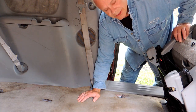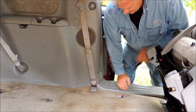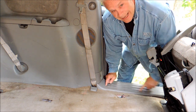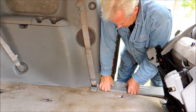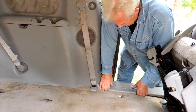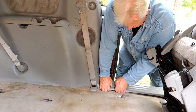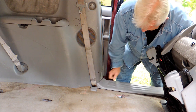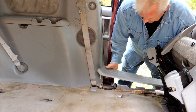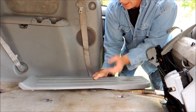Welcome to Car Questions. One of the first things you need to do is get your seat out of the way. The very first thing: you're going to remove this plastic sill. Get your fingers — you could use a small pry tool — but I find just using your fingers at the edge and working them along, pulling up evenly, straight up like that. Out it comes; it just has a number of clips and pulls straight up.